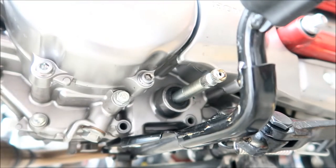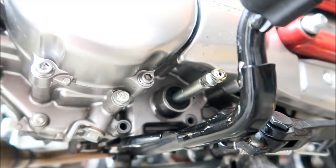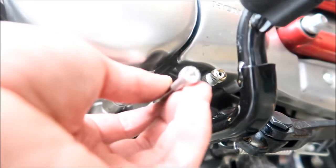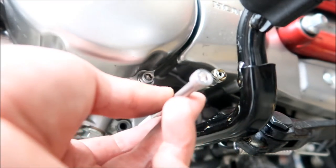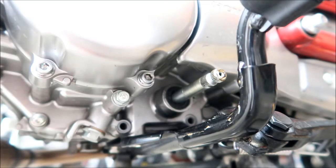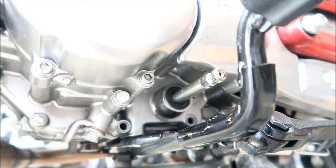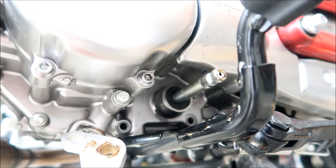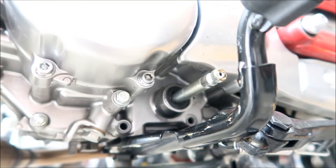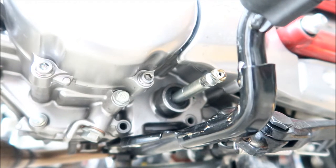This was designed to be pushed all the way in, and then you use the bolts. If I try to make it a longer spacer so it sticks out farther, it'll give some support but the bolts aren't long enough. So what we're going to have to do is enlarge this hole so it'll fit over the shaft. This is not cool — this should have been a bolt-on install. I'm kind of pissed off now.